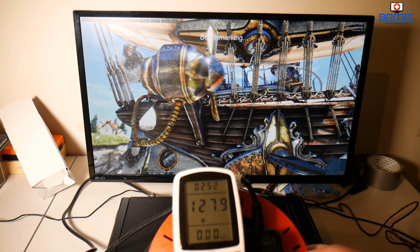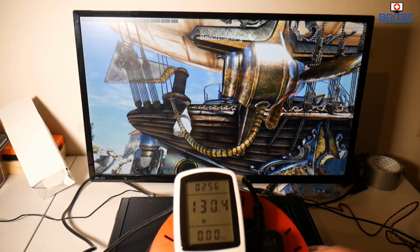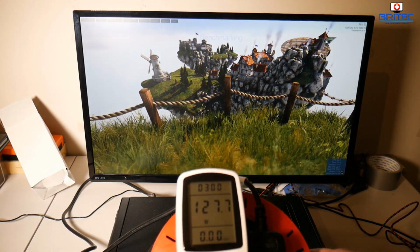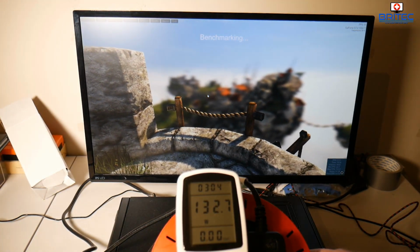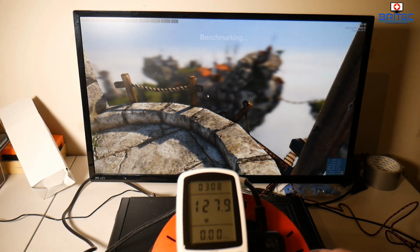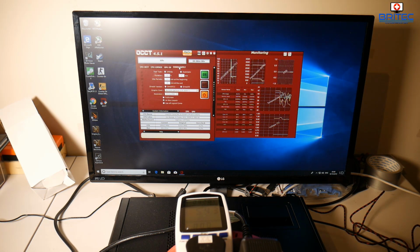Now also some graphics cards will require additional power via a cable, but the low profile cards don't require any additional power, so we don't need to worry about that, and it will draw all its power from the PCI Express slot itself. So we don't have to worry about any additional power being delivered here. Now obviously continuous power for this power supply is 250 watts, which means that's its maximum wattage. You can't go above that, otherwise it will become unsafe.